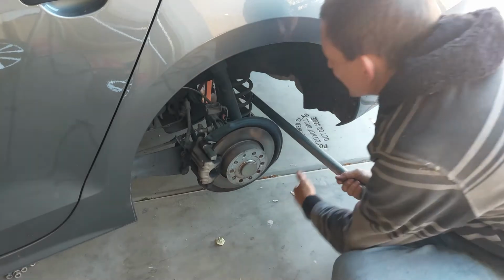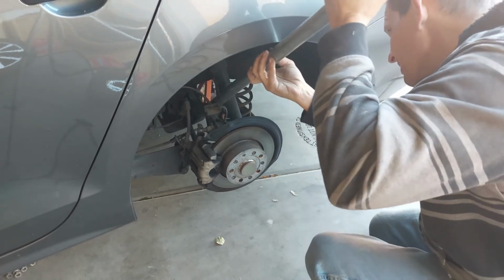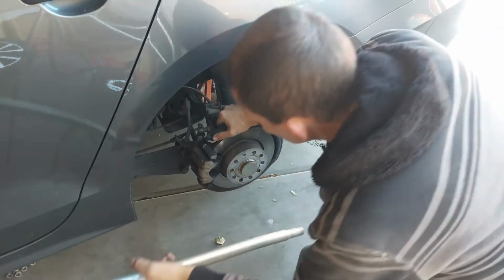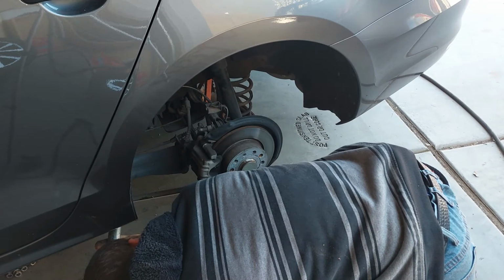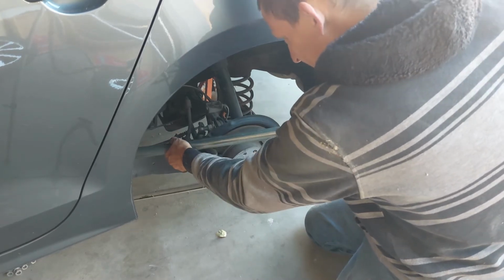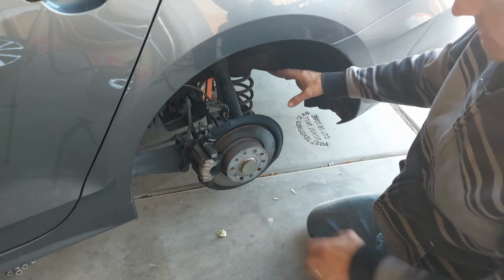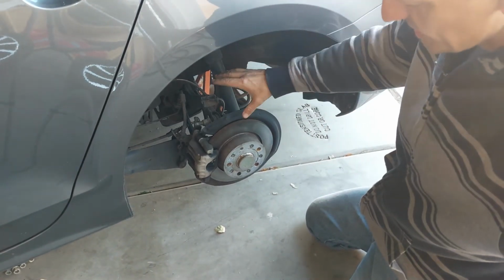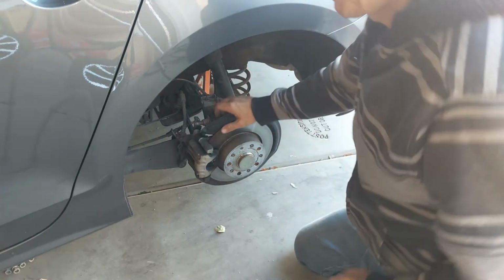So when I pry in there, I don't see any movement at all. Let's see if I can get it into the sway bar. Everything looks good there. Looks great there. Okay. And then we'll put this in the bottom one and give a good look at the bottom one. All right, so the bushings on this side look spectacular. I don't see anything wrong with this side here. I'm going to repeat the process with the other side, and then we'll move to the front tires. Woohoo!